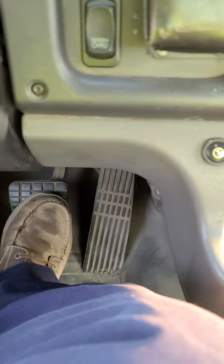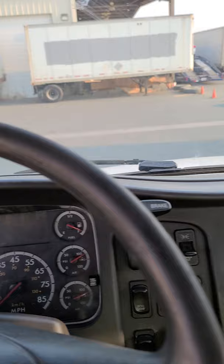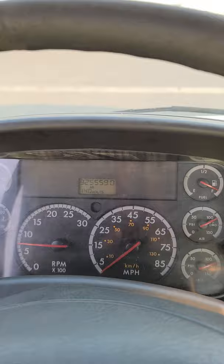Now I'm going to test my service brake. I'll put my foot on the brake with enough pressure to hold the vehicle, then release both the trailer brake and parking brake. I'll say: 'I'm going to move forward less than five feet.' I pull out, check all my mirrors to make sure it's safe, then move the vehicle about three or four feet for the DMV. When the vehicle is moving, I brake and say: 'This is a good test, my service brake is holding my tractor and trailer combination in place.'